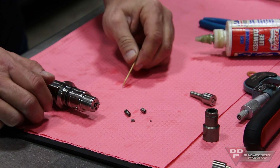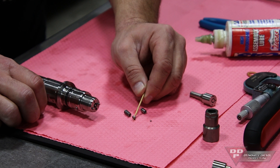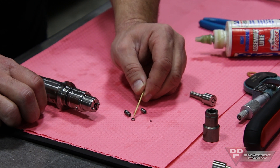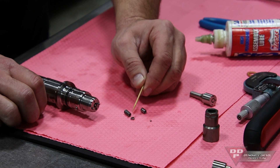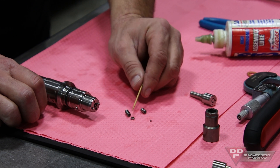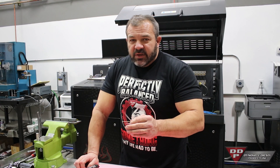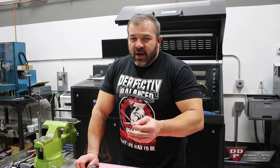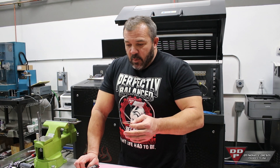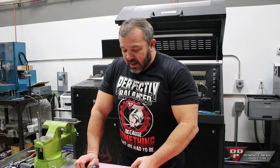Here's how this stuff works inside. We've got a spring with pre-tension on it — this is called the DFK — and that's responsible for idle and just after idle, the tip-in. We can change these here at the shop to make sure idles are within like two cc's of one another. The factory spec allows a 10 cc variation, but we don't choose to let them go out like that. If you send them in, this is one of the things we calibrate. This sleeve holds what we call the DNH.